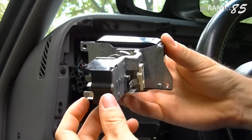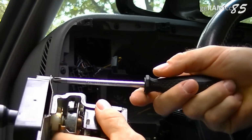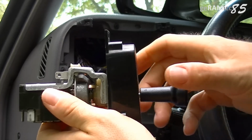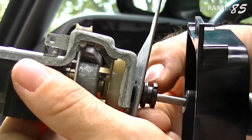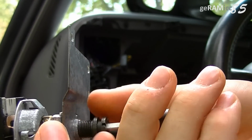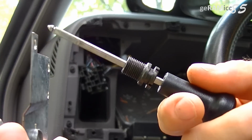Now that you got out the unit, take off the 3 small metal screws from the back that are holding the plastic in the front. Now pull out the pigtail as far as it goes, and then remove the plastic too. You find this little metal part here. Twist it around as the pigtail comes out. If you have loosened up this little screw here, after that you should be able to remove the pigtail from the housing. Now this sometimes can be a little difficult.